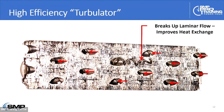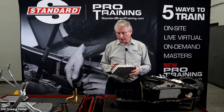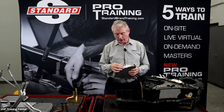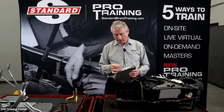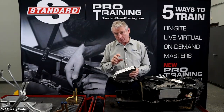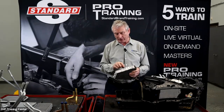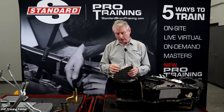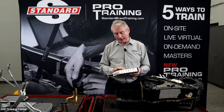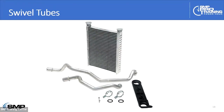The next piece of technology is what we call a high-efficiency turbulator. This is incorporated in the mechanical design we looked at earlier, but it doesn't have to be — any tube-and-fin style heater core may have this technology. If you look inside the tubes, I've pulled one out and it looks almost like a corkscrew. These fit in the tubes and act to disturb or create turbulence in the coolant flow, breaking it up to provide better contact between the coolant and the surface area of the tubes. It improves the efficiency of the heater core — we call this a turbulator enhanced-efficiency design, and you can find it typically on many older tube-and-fin design heater cores.